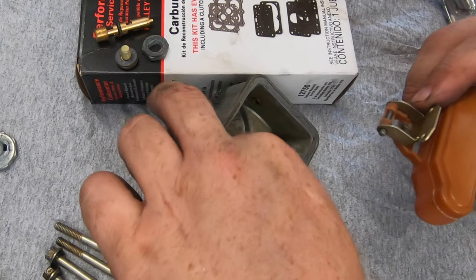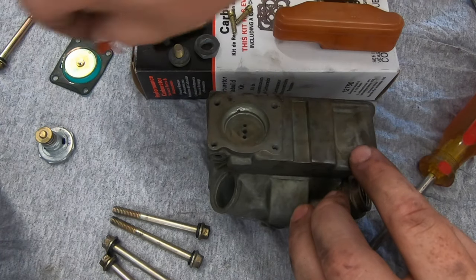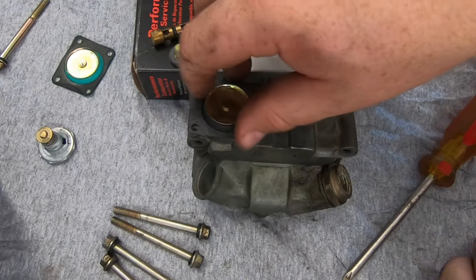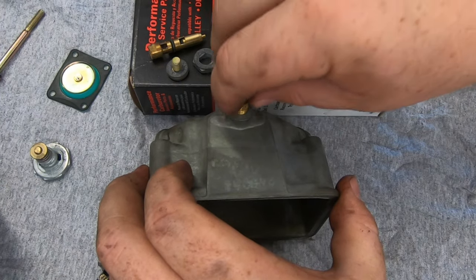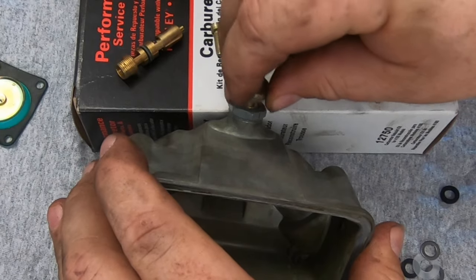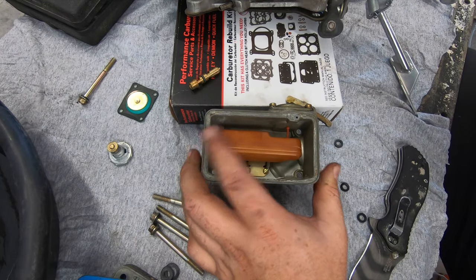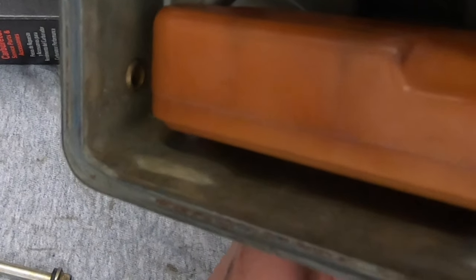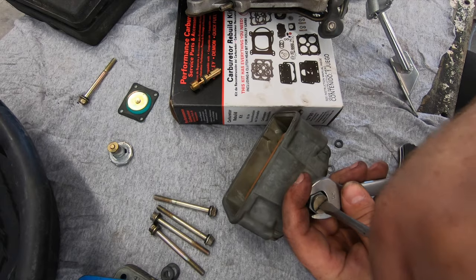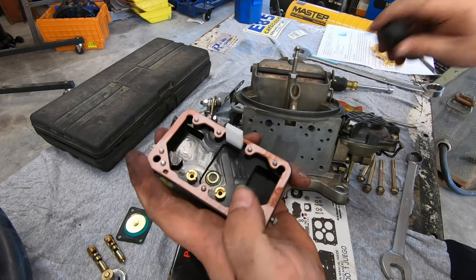The float only needs to come out if you don't already have a plastic float. Make sure that little ball on the bottom of the rubber diaphragm pops through the bottom of the bowl. This bracket needs to touch the needle and seat — magnetic screwdrivers make this job so much easier. The seam for the float bowl should be at the bottom of the plug while holding the bowl assembly upside down. Thread the needle assembly in until the float bowl is in the right place, then snug everything down. Next, change out the bolt washer gaskets, run through and make sure everything's tight.